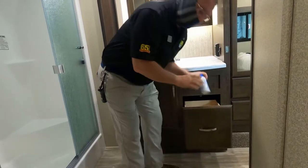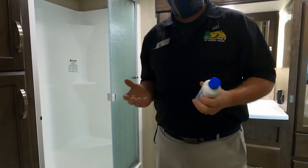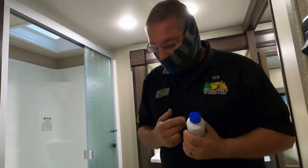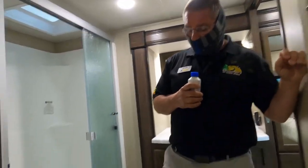I've used Happy Camper in the past. Okay. And we have a tub of that waiting for us. Success with that? Yes. Continue using it. Follow the instructions. You're going to start off with your choice of toilet chemical and at least 2 gallons of water. How much is 2 gallons of water? Fill that bowl up 3 times. How are you going to fill that bowl up 3 times? Press partway down on the pedal. That's going to put water in the bowl.